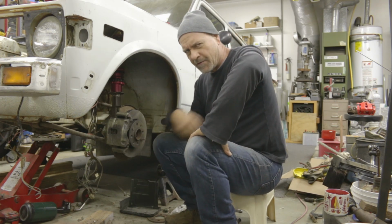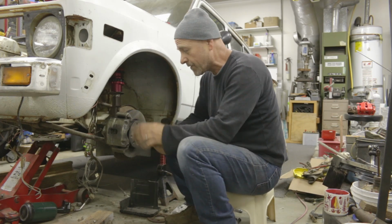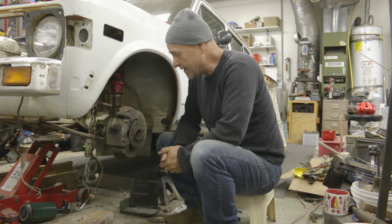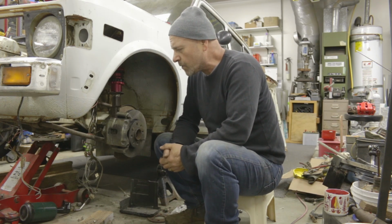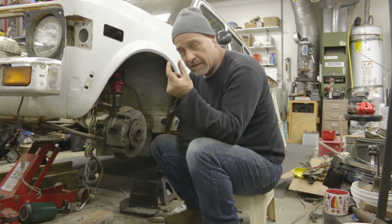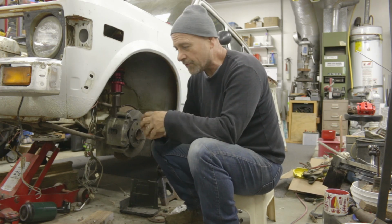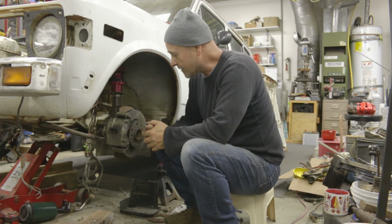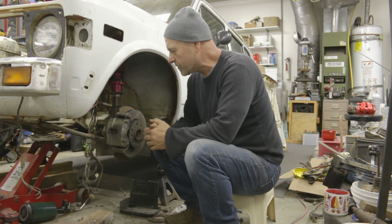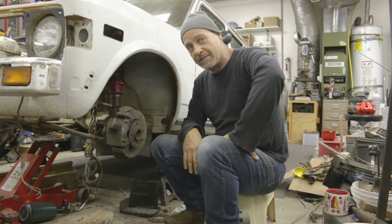Oh, and back when I was having that brain fart while holding Zilly, I was discussing the mounting bosses, the lugs for mounting calipers onto the hub. And yeah, there's plenty of meat. Essentially, all that really needed to happen was for the entire hole to be opened up by 1/16th. So a 30-second on either side, all around the circle, 2 30-seconds equal a 16th. So it's not a huge hogging out of the holes to make these fit and work. And yeah, I think this is going to be a very good solution.